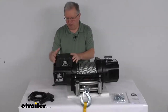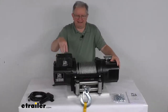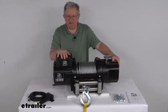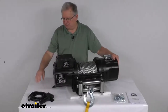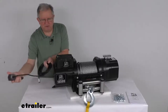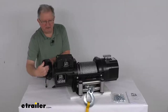If you prefer the power unit not being on top of your motor, you can remotely mount it somewhere with that wiring kit sold separately. The power unit has a sealed 500 amp contactor which transmits power from the vehicle's battery to the winch motor. It is water and weather resistant to IP67 specifications. It also includes a rubber handheld remote with a 12 foot lead, and the toggle switch for the in and out feature is weather resistant.